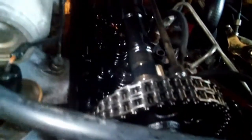So that's that. So I'm gonna start with this first cylinder. If you're not sure, this thing has a firing order 1, 3, 4, 2. So I'm gonna start with the first cylinder. This is the first cylinder, and I'm gonna start with my exhaust valve right there. I'm gonna loosen the upper nut and that one and start working with it.